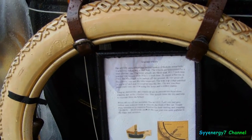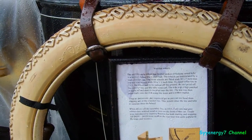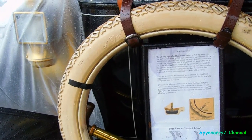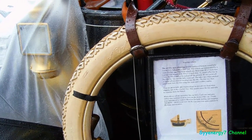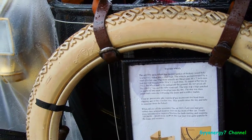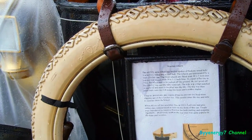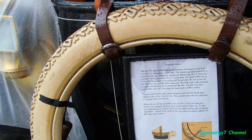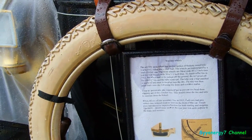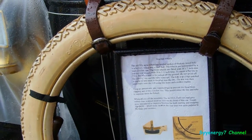There's an argument about fat tires versus skinny tires in the snow. The rear wheels are 30 by 3 and a half. You're flat on this — there's a tube, it's pneumatic, and it requires 65 PSI to prevent the tire bead from slipping on the clincher rim. These aren't safety rims.